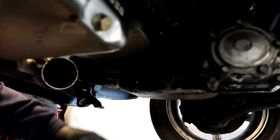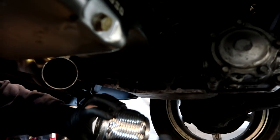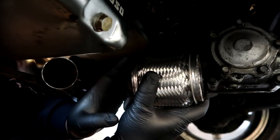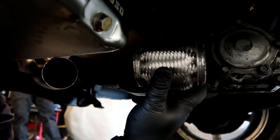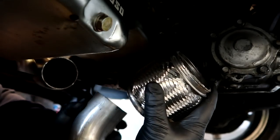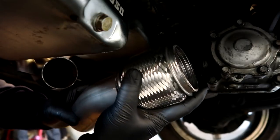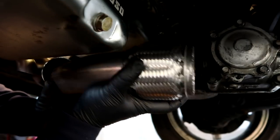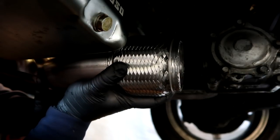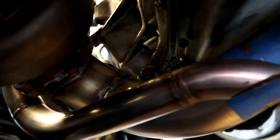But just as a reference, I do want to keep the flex tucked up pretty high, after the oil pan, before the transfer case, so somewhere right here. And this is like that 45 that I need, right? But it's too short to put it where I wanted to go. Or I thought it was short. I think I figured it out.